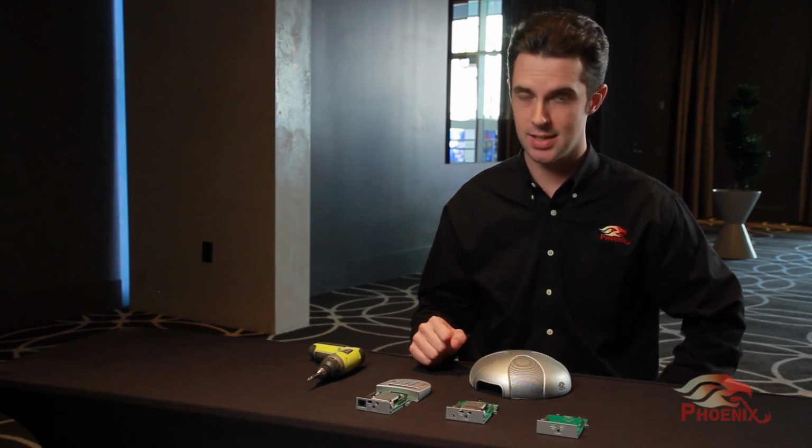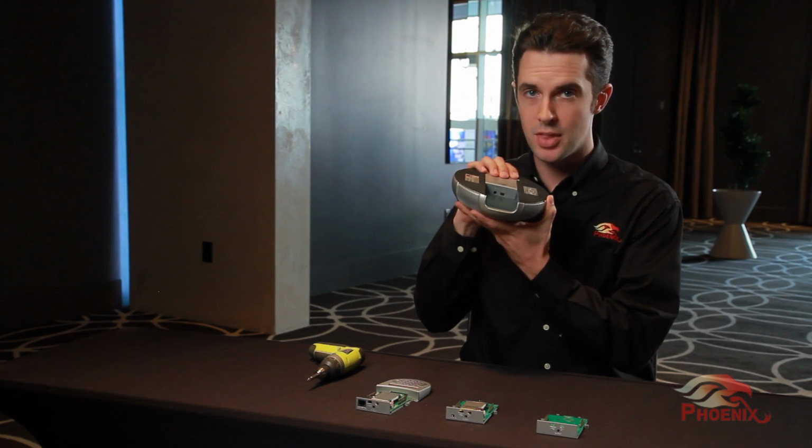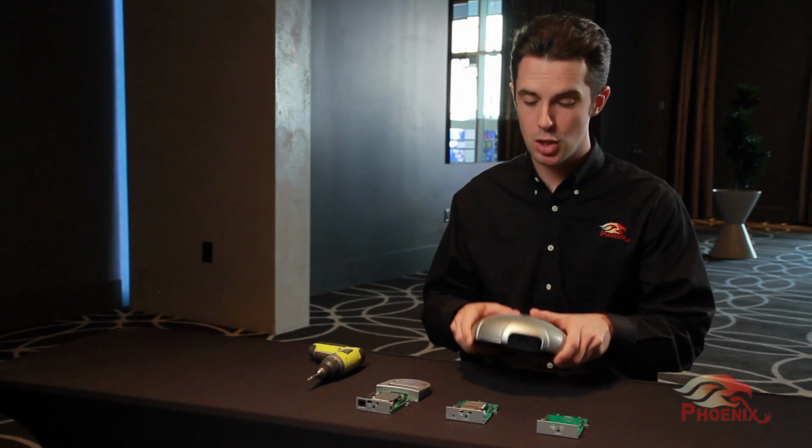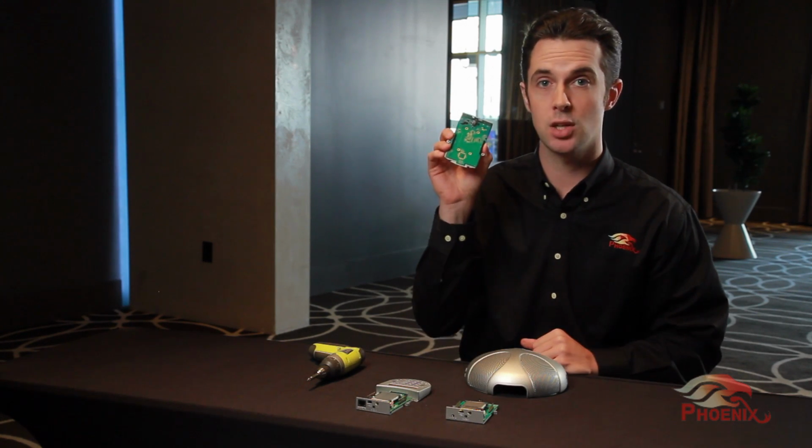As you already have noticed, the optional interface cards all come with a DC jack that supports our powered chain scheme. However, this jack does not exist in the basic MT301 unit. If you need to support the powered chain scheme with the basic unit, you can use our third interface card, which we refer to as the power chain card, or the MT324. This card has only a DC jack, and it does not add any connectivity to your Quattro, but only the ability to support powering a chain of Quattros from a single power source. A unit that is pre-fitted with this card is called the MT304.